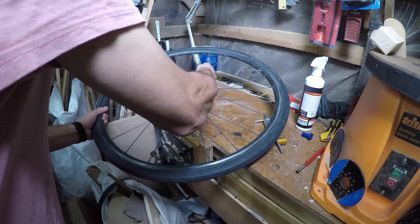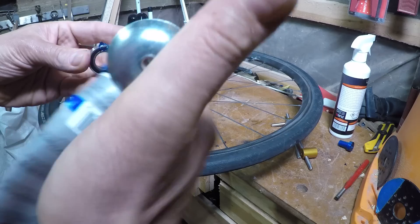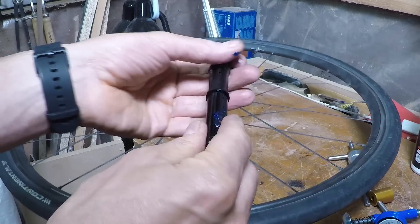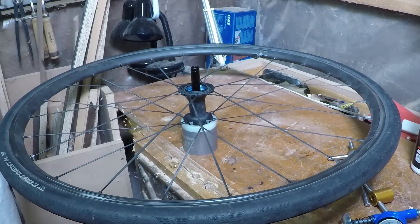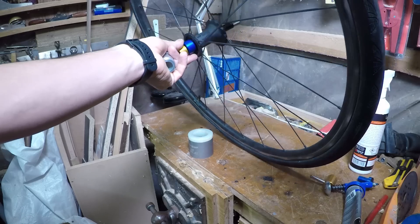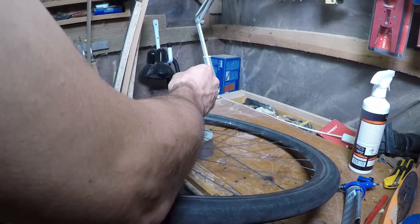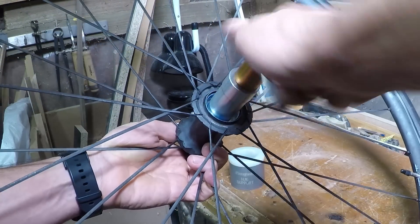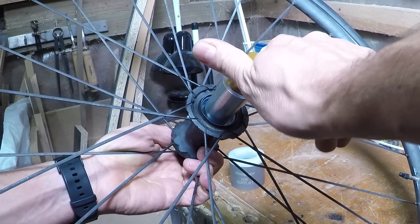Apply a little grease to the drive side of the hub. Lightly grease the bearing and the axle itself, and insert it into the hub body through the non-drive side bearing. The drive side bearing on this hub is a 15267 — again I'm using a ceramic bearing. I'm using the RRP tool again to press fit the bearing in, but you'll need some sort of spacer. I happen to have one of the tools from fitting Hope's bearings, the HTT 182 tool, which slides over the axle itself and then pushes onto the 15267 bearing. But you can just use whatever you can find that will fit over the axle and push on the outer ring of the bearing. Again, don't over tighten.